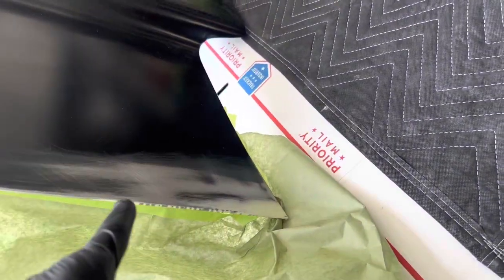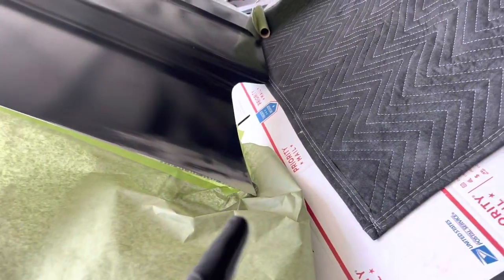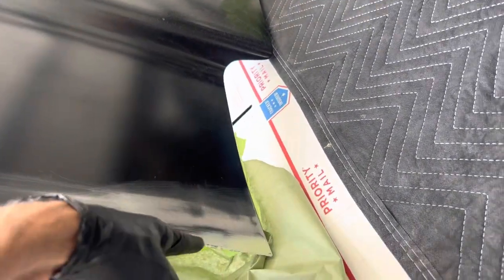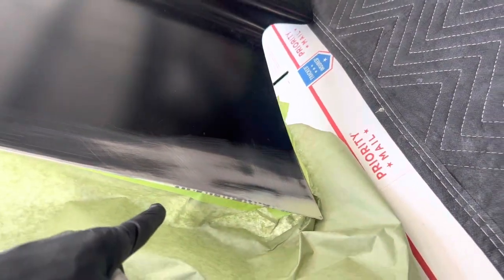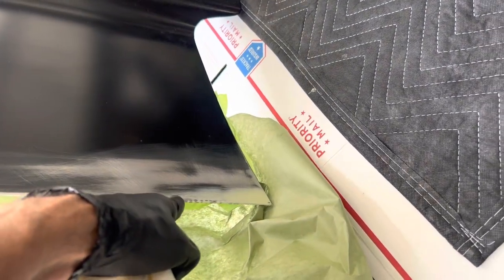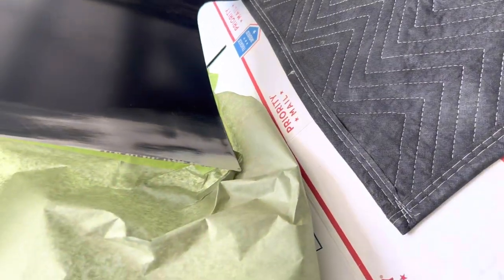This spot on the hood was my doing. Previously we had the car mocked up and I decided the gap was too tight and that the hood itself wasn't straight — it kind of tapered at the end. I got my flapper disc and was going along the edge and I broke through the seam, went too far with it. So today I've spot welded it back in. Al put a little skim coat of putty on there and we're going to dust this in with some epoxy primer too.